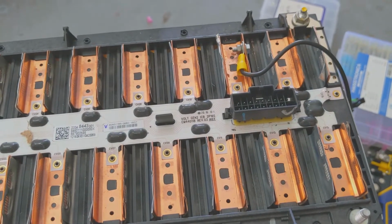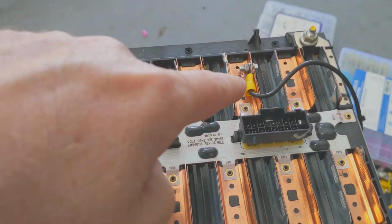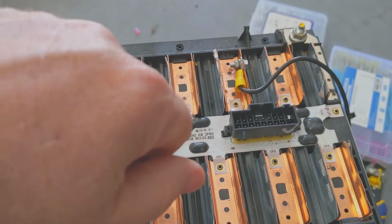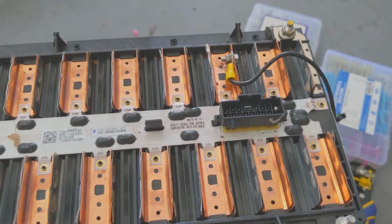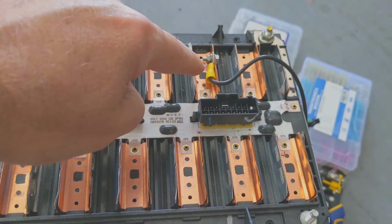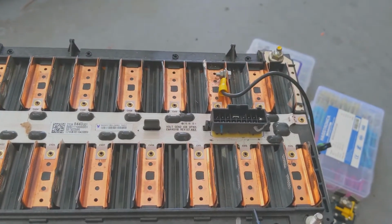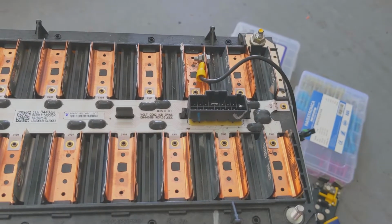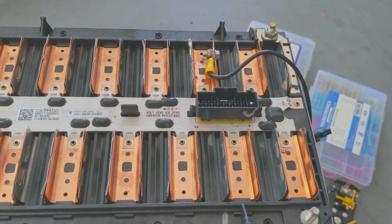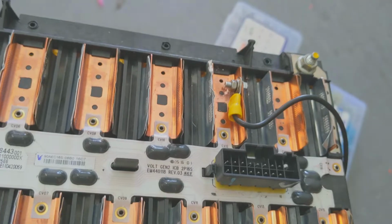So you have 2 options. You could tie together the minus 13 lead, which is going to be that black lead in the last group or the second group, with number 12, and from a voltage standpoint, it would be correct. However, I spoke to the people at Orion, and they said what we prefer you do is actually put a cell tap here on number 12, and then we'll call that minus 13. It seems like they would be the same thing, but it actually does make a difference in the voltages. It only happens a couple places, and when I was building my pack out and the way it's oriented, I only had to do it a couple times. So I just drilled a hole in there, and that's a 4mm bolt, and put it in place.